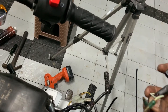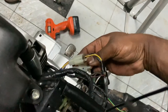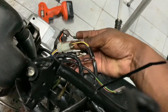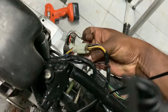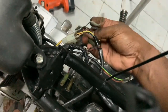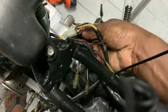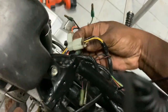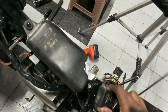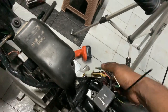The CDI has three individual wires and a two-pin connector. The two-pin connector goes into the two-pin slot in the wiring loom and locks in. Then all you need to do is match the wire colors. There is a black-and-white female that connects to the black-and-white male in the wiring loom. It is really difficult to do with one hand. Then this kind of screws in from under - you need to connect those.